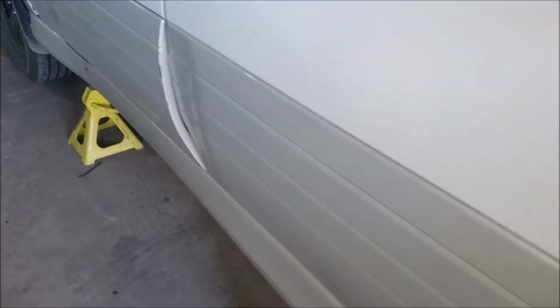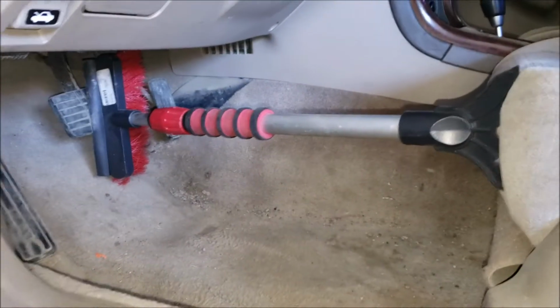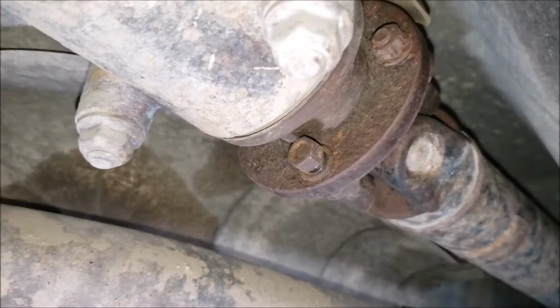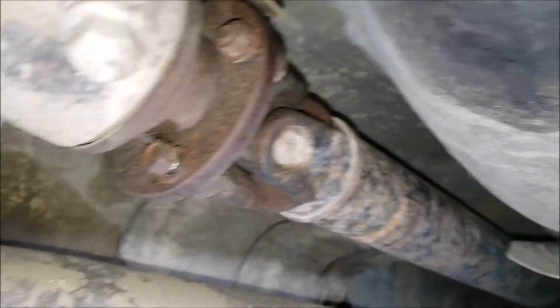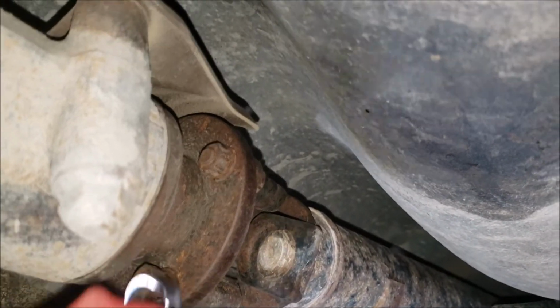Oh yeah, I'm not sure how good the e-brake is on this car, if it's gonna stick or not. So I just jammed my snow brush on the brake just to stop the driveshaft from turning. Show you under here. So just getting the rear bolts out. They're 12 mil. You can't get anything on the back side, so just cracking the nut side.